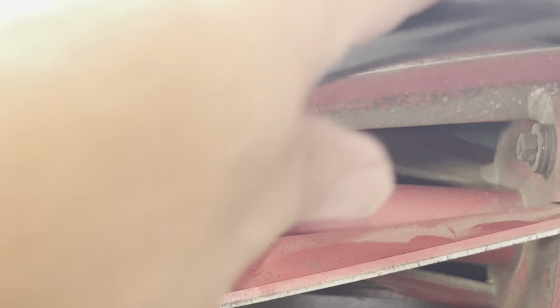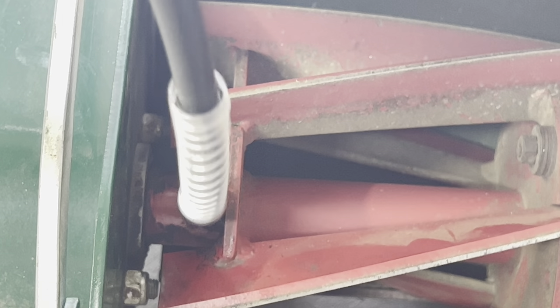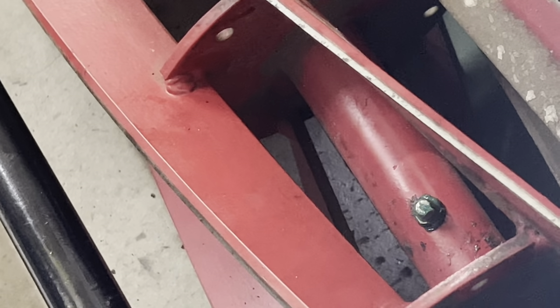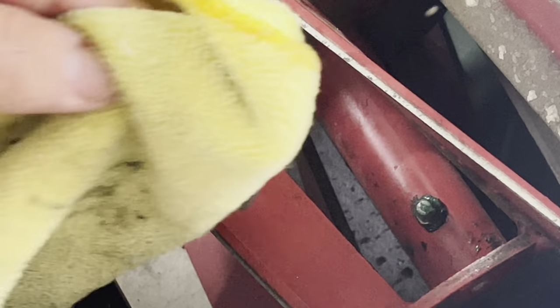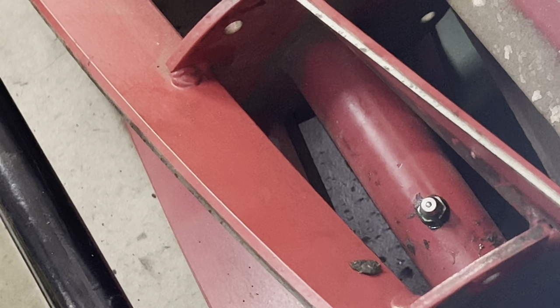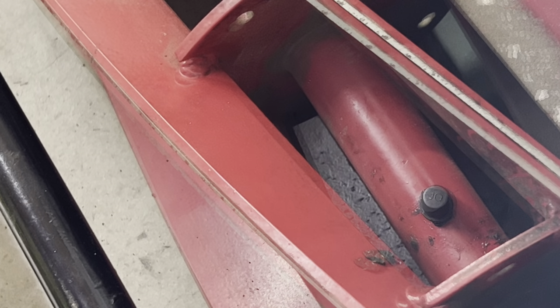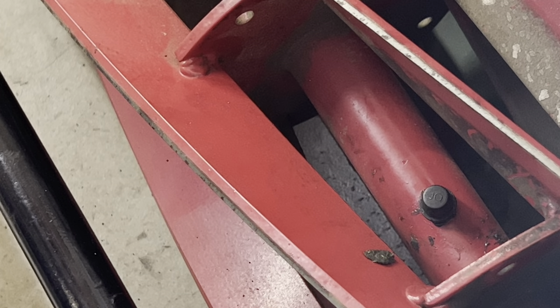About three pumps there, and I'll just twist this to get it back off. One thing I normally like to do after greasing my fittings is wipe them off with a rag to clean them up. As a quick tip, I purchase Zerk covers that basically cover up the Zerk fitting when it's not in use — I'll post those in the description so you guys can see which ones I'm using.